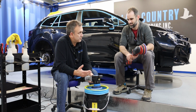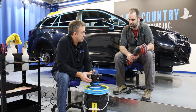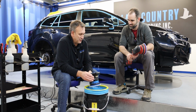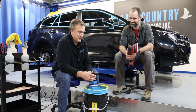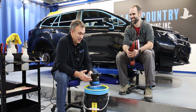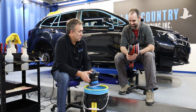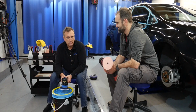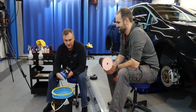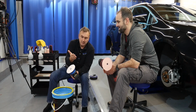Before I turn it over, you see what I've done there: rubbed it off the surface, ramped the speed up gradually, lifted the backing plate so it's not quite touching. Now, one of my good detailing friends, who's got one of these and loved it, messaged me saying it gets him soaking wet. And I had to explain to him, a washing machine, and that sounds crazy. When you've got your clothes in a washing machine, I said to him, it doesn't go to 1200 spin instantly. It ramps up to shed some of the water, which is what I've done now. So this is now not soaking wet. Feel that?